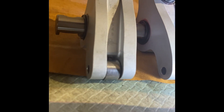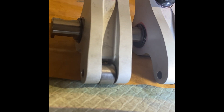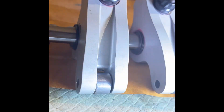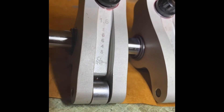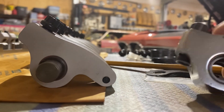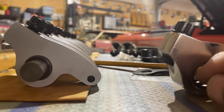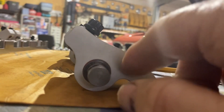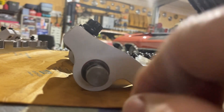The pressurized oiling runs from the pushrod to the trunnion and then over to the spring with that little hole right down in there — I think y'all can see it right there. The oiling hole was an option I elected when I ordered the parts, plus the Performance Quotient had needle bearings in here, and the Scorpions have a brass bushing in there.